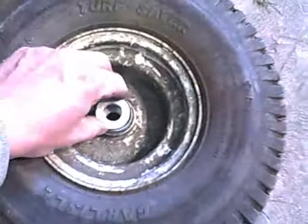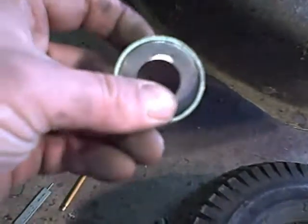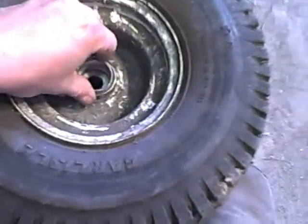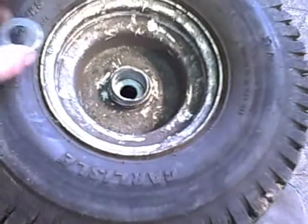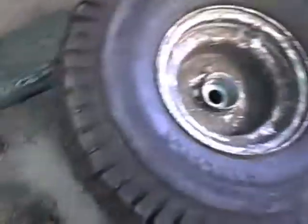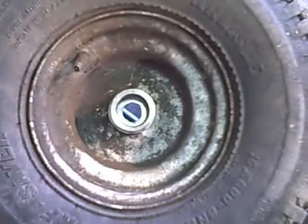What I want to do is put this washer, which I had to drill out to fit the spindle — it's hard to do this with one hand. With a little bit of work I can get this to fit flush in here, so I'll weld that in. My theory is I should be able to bash this into the rim, give myself a new spindle.